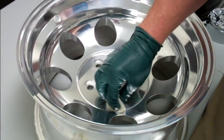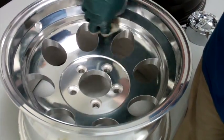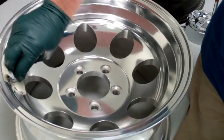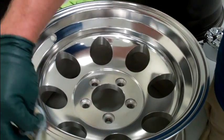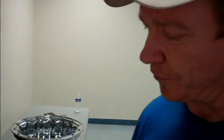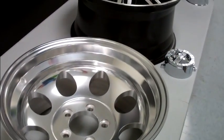Then we get back to the center — one quick wipe to tie everything in together. As you go around these spokes, just kind of make a little pass down and around, then follow the wheel out. Just try not to lift the rag if you can; you're kind of climbing out of the wheel with your applicator rag and off the edge, so you don't leave any smudges from the product. This wheel is sealed to the point where you really don't have to worry about any environmental damage or chemical damage. If you run through a car wash and somebody puts the wrong chemical on this, where it otherwise would turn white, it's going to repel it and look just fine. Nobody's ever been able to do that for polished aluminum before.